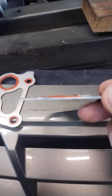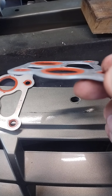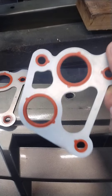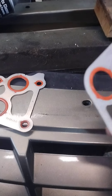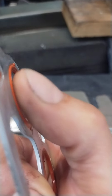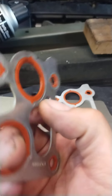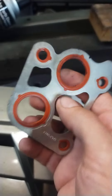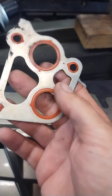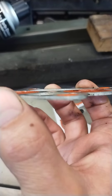I'm going to show you a trick on how to do that in a minute. But if you look down this seal — do you see how — let me get the camera to focus — there we go. Can you see the lips? There's a lip on that seal, and it's on both sides. I suggested we do this because this car is actually really notorious for this, and I checked this one — it wasn't leaking. I showed you a video of the oil pan pouring out, but if you look at this seal and you look down the edge...